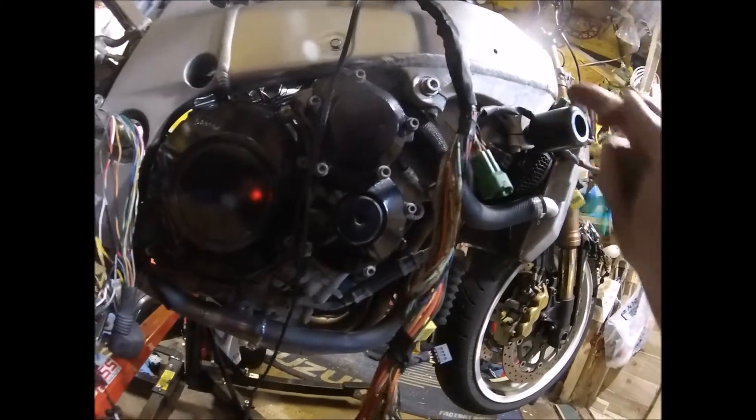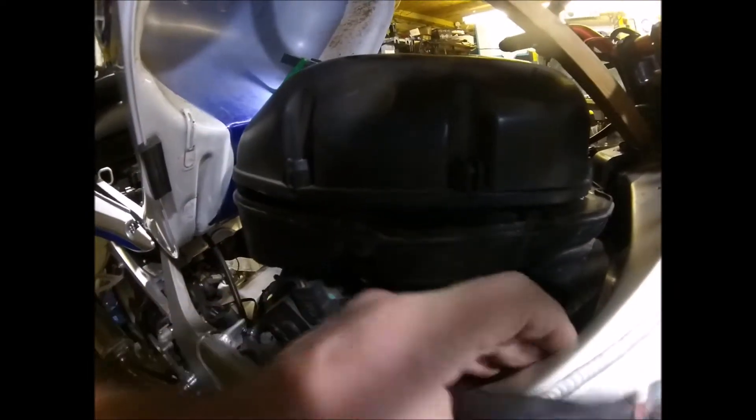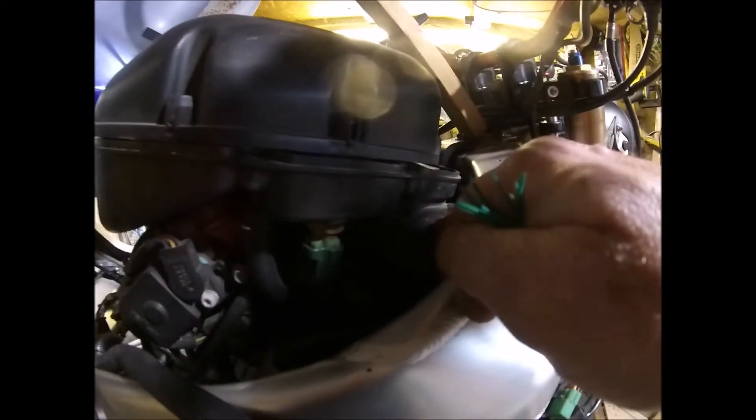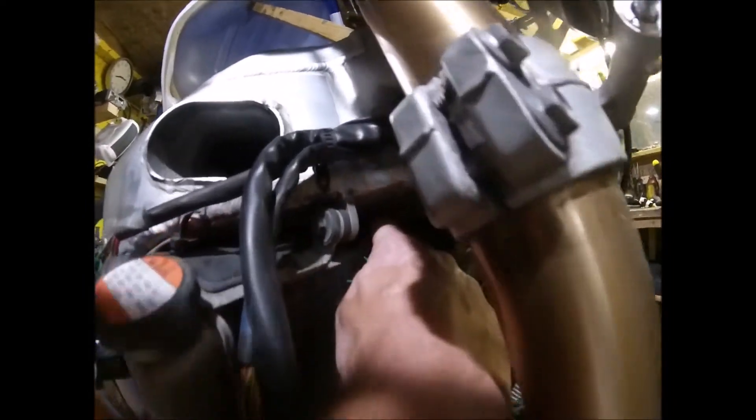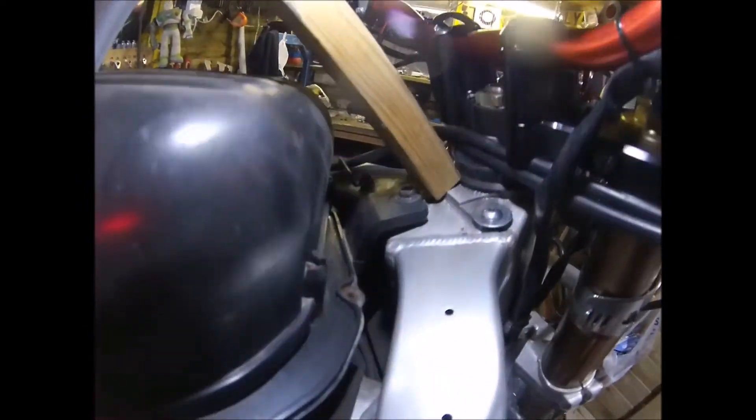As I go through things like the indicators and stuff like that, all the wiring will be cut down. So I'm re-routing it up the side of the motor here and it will go underneath the air intake — there's room for it. Hopefully all the plugs and everything at the front here, these wires will be taken off and fed up through in there on the top of the radiator. I'll have to swing the radiator out of the way to give me room to do that. But all these plugs will join in this gap.